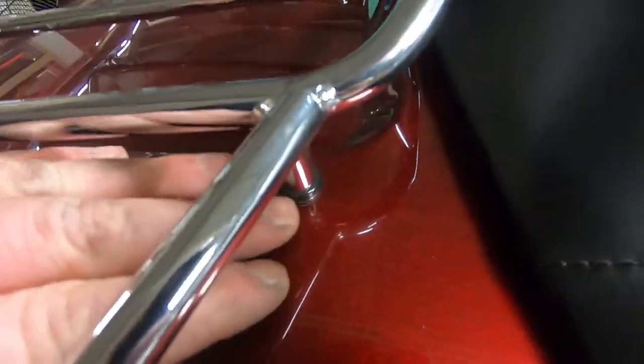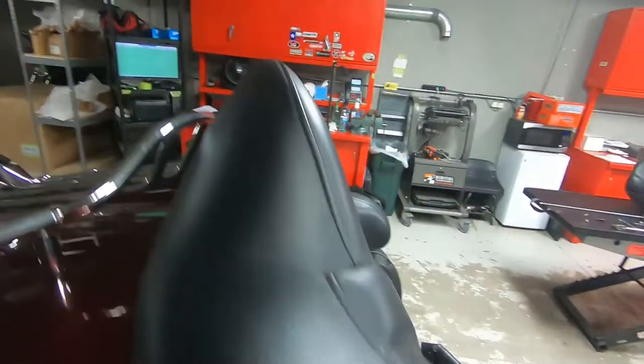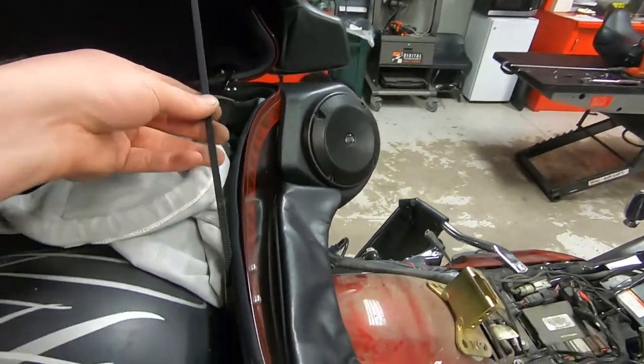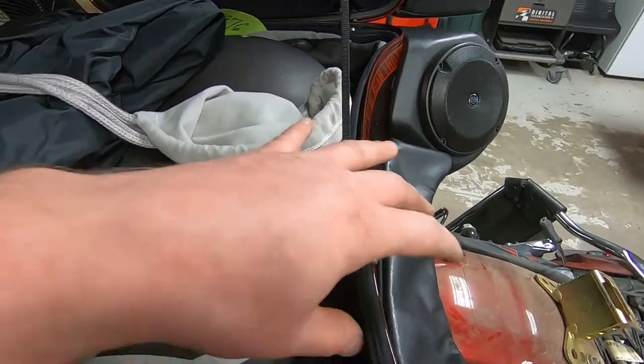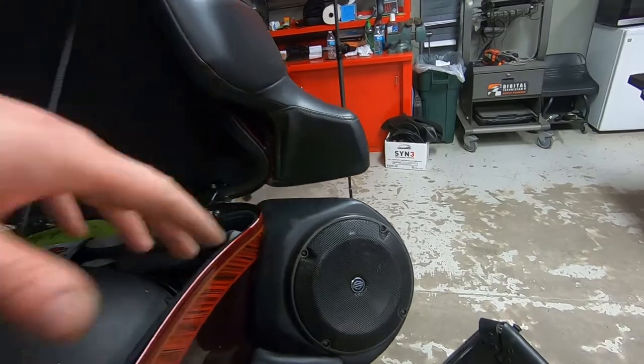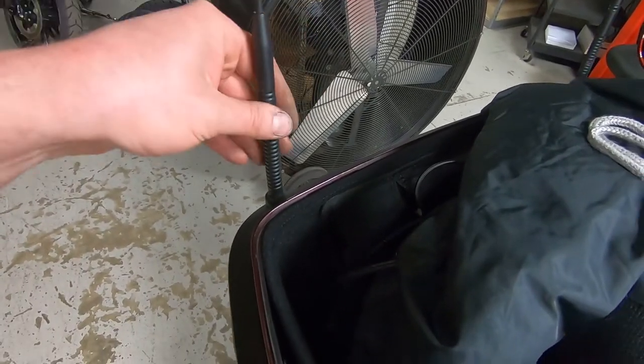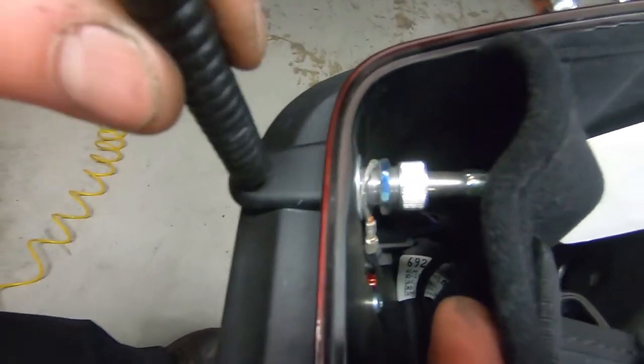I like to look around the little plastic grommets for the tour pack rack, make sure there isn't any weird looseness or buckling. Everything's looking good there. You want to check the tether — that everything's tensioned and correct. Same with the rubbers on the backrest; there are three rubber isolators and you want to make sure they're in good shape and not broken. Then check your antennas. One feels kind of loose, and this other one has a real situation going on — everything's all loose, and it's rusted and corroded. Not good at all.